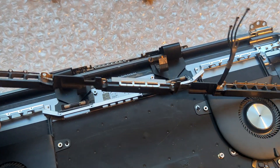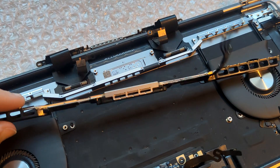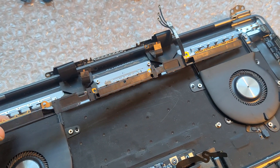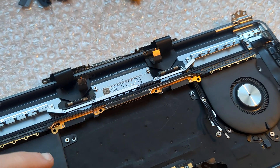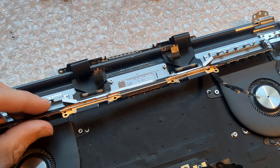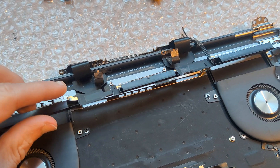In the meanwhile I decided to test this. I cut some plastic and used some tools to modify the Wi-Fi antenna holding part. Since the cables affected by the flex gate issue run around this part, I figured I would try to trim it this way to make it a little bit more gentle on the cable, and maybe prevent it from failing.